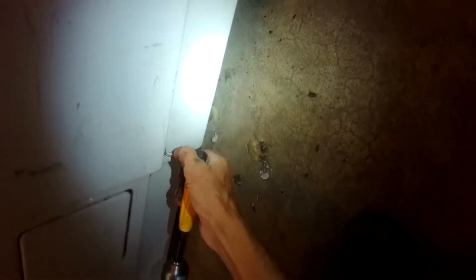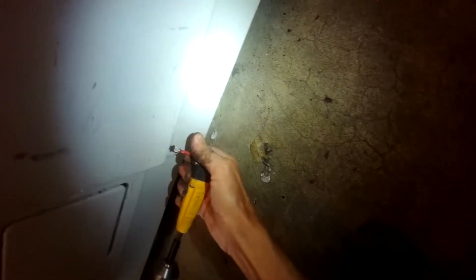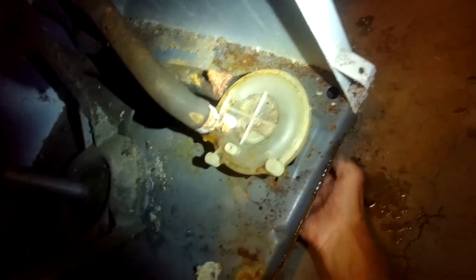I'm spinning out the two Phillips head screws on the lower part of the front panel to remove it so I can see what's going on during the spin phase. I'll pull the panel out toward me to about 45 degrees — that releases the upper clip so I can get it out of the way. It looks pretty corroded down there, a lot of rust.